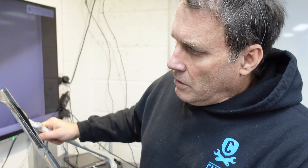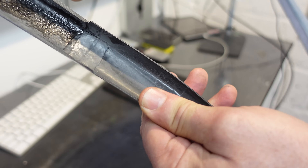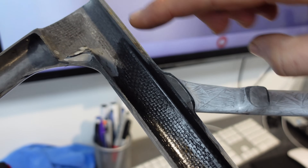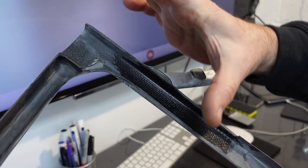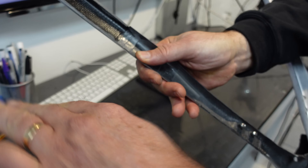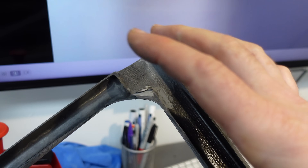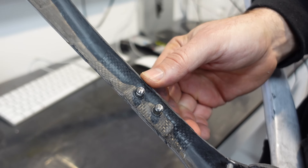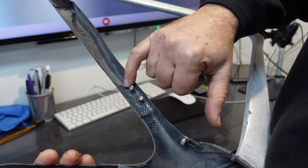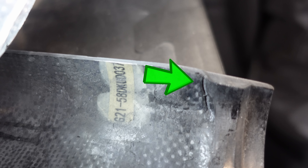What about the wall thickness overall — much variation? I keep saying it's safe. This is quite thin, this is quite thin, and this is very robust. This whole construction here for the seat post — which sits in here — is around about the sweet spot, because if you break this way you snap this weak area, that part breaks out and it snaps on this section here, breaks where it's like a house of cards and you come down. Also around here, they've done quite a lot of thickening in this area for the front mech. It's got a big lump in it — not because they're structurally making it thicker, but because there's a molding on the side.